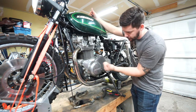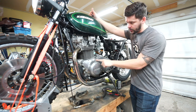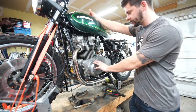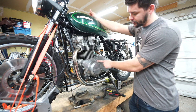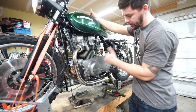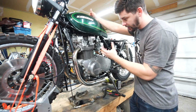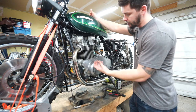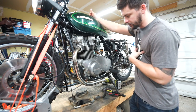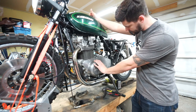I'll probably grab my impact driver. If you guys work on any of these old Japanese bikes, you'll know that these aren't Phillips screws — they are JIS, Japanese Industrial Standard. They also tend to strip out, so if you use a Phillips head screwdriver on them, especially if they haven't been removed in years and years, there's a really good chance you're going to strip them. An impact driver and the proper screwdrivers are a must-have. I do have the impact driver I use linked on Amazon in the description below — it helps support the build and doesn't cost you any more money.